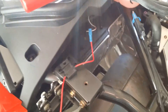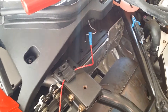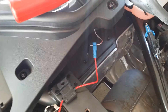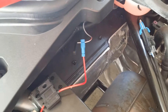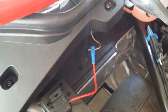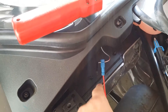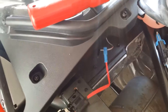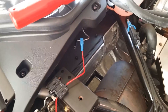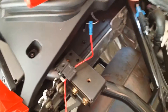The next part of the install is to hook up the 12 volt ignition lead so we can get a signal when the key is turned on to the fuse box. We're going to tap into the positive line on the cigarette lighter in the glove box on the passenger side — that's a gray wire with a red stripe. I disconnected it from the cigarette lighter to make it easier to access, but I'm going to plug that back in now. The kit comes with this wire tap — you don't have to cut anything. It taps into the inline fuse, and then the yellow wire goes back into the fuse box to give us our ignition signal. You'll want to wrap all this with looming so it looks factory.